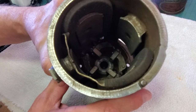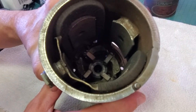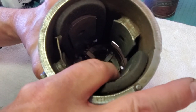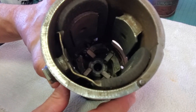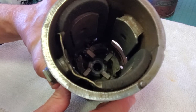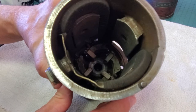Down inside your starter you're going to want to remove every bit of dirt you can possibly remove. Don't try to scrub things clean — I'm just talking about heavy dirt, get that out of the way. If things are really rusty, you want to gently remove that rust. I suggest using small wire brushes, and a Dremel-style rotary tool is the easiest way of doing it.